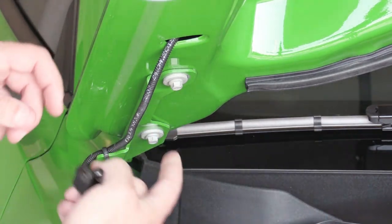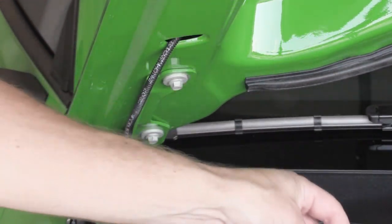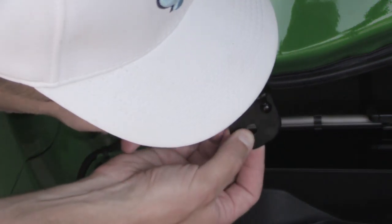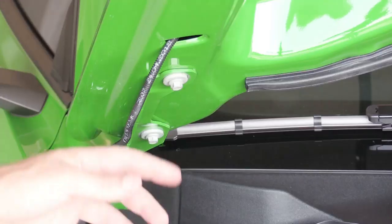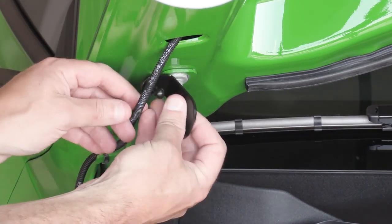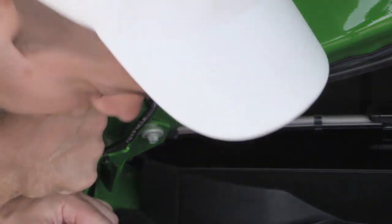The first thing we're going to do is install this bracket. You've got to make sure you grab the correct one — if you put it this way it's not going to line up, but if you grab the correct one, this little 90-degree angle is just going to sit there and then this is going to sit inside like that. All we're going to do is disconnect this nut, slide this thing in, reconnect the nut, and tuck it in. Also make sure that 90-degree angle is all the way pressed down. And that bracket is done.